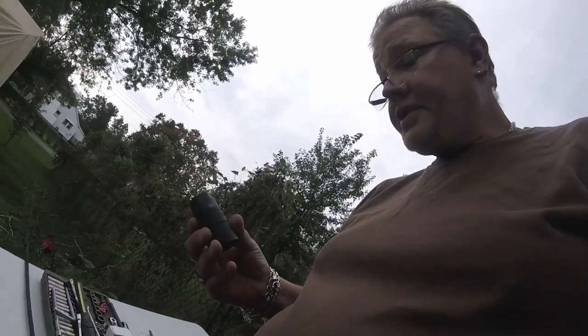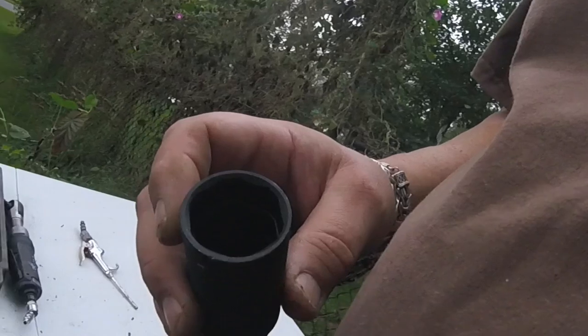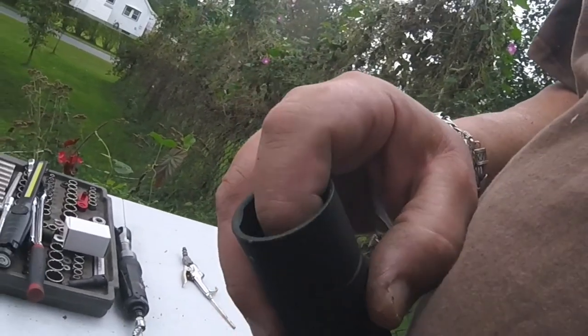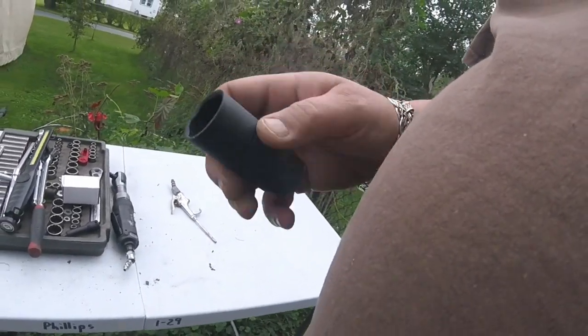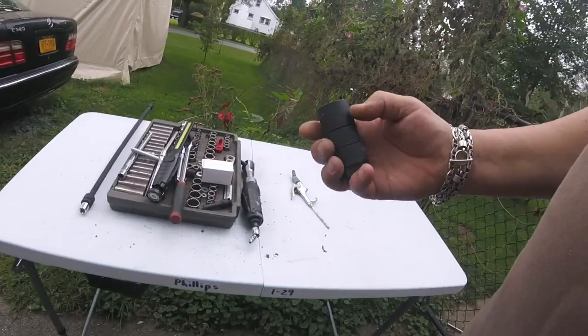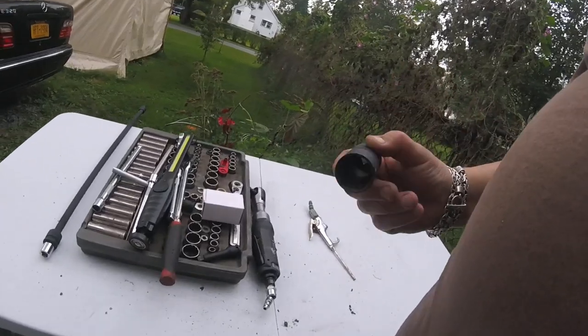The tool you're going to need to replace the oil pressure sensor is a 1 1/16 socket. This is a special sensor socket. It's all hollow inside. Some of the 1 1/16 deep wall sockets are not open that deep in there. They'll just have like that much open to 1 1/16, then it's smaller inside. So you're probably better off getting one of these sensor sockets.